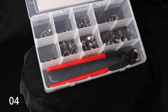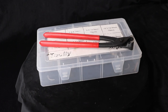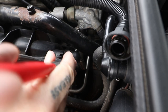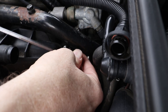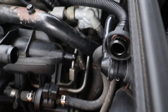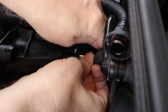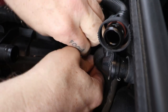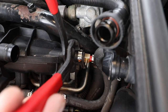If you want to buy single ear clamps, and I recommend it if you own an Audi, use my affiliate Amazon link in the description below. To remove the rubber cap, I used the single ear crimpers and cut the old band, then pushed the cap off using a flathead screwdriver. My new adapter slid on fairly easily, so I aligned it, and then used the single ear crimpers to crimp the adapter into place.